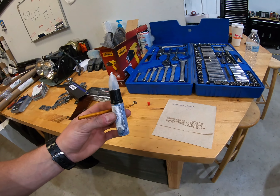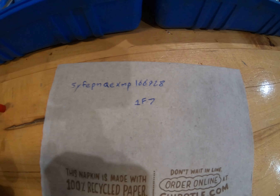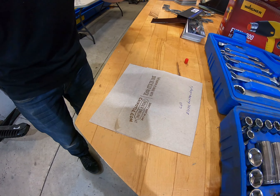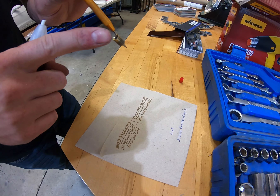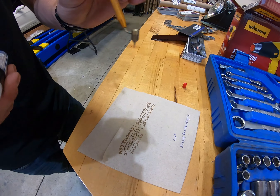I use these pens to fill paint chips — I get them on Amazon, they're like $6. They're like old ink-style pens that you fill. They're perfect for filling rock chips and scratches. The paint code I ordered is 1F7 for this, it's a silver. You just make little dots and fill the whole chip. Paint shrinks as it's drying so don't be afraid to overfill. As it dries it'll look a little smoother.